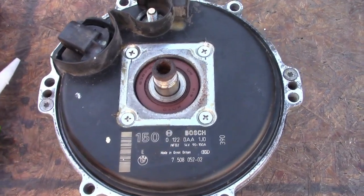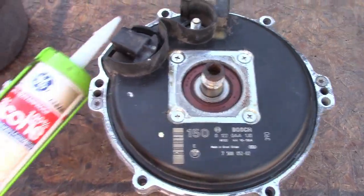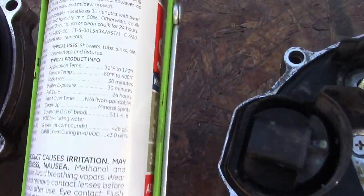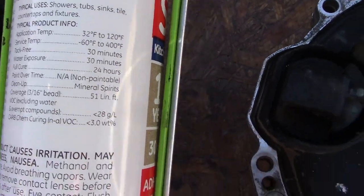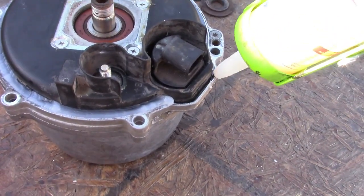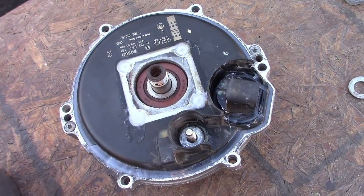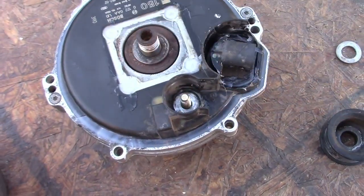What's left is to put silicone back on here and over here. I'm using regular kitchen, oil-based clear silicone — it says the maximum operating temperature is 400°F, so that'll work. After the silicone, this is how it looks. Now put the pulley back on.